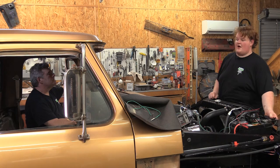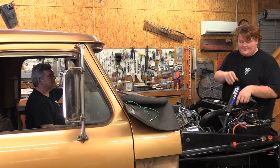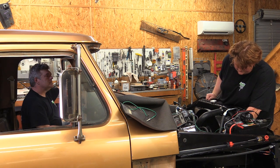Jeff. All right, got Jeff in the truck. He's gonna pick it up to about 3,000 RPM, and I'm gonna mess with the timing deal and see how much total timing we have. Ready? Yeah, go ahead.